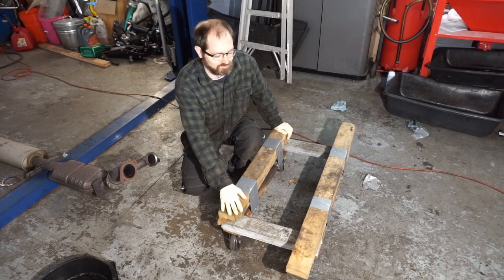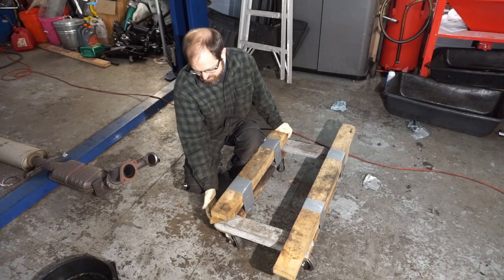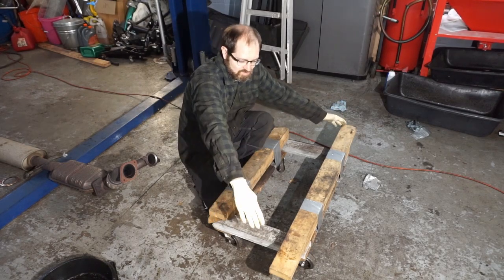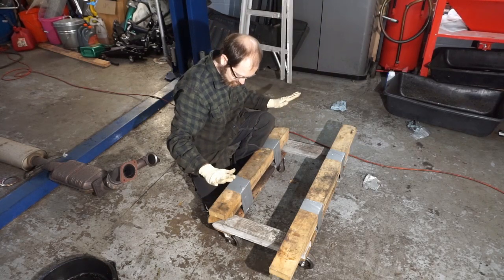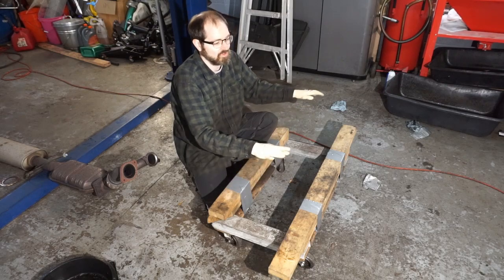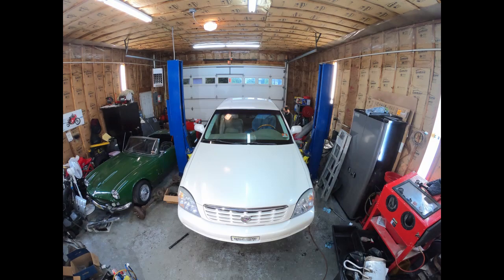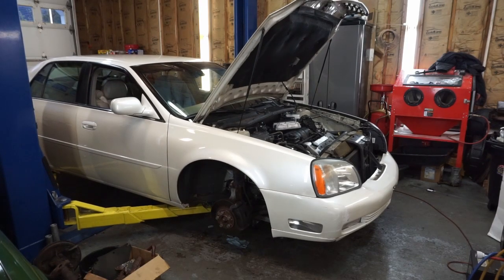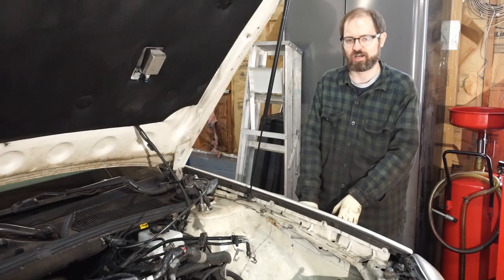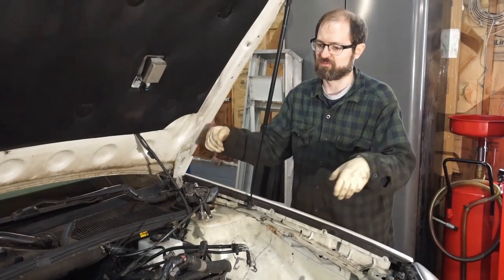We've made this support dolly for the cradle — it basically consists of a 1200-pound piano dolly made of hardwood, and then we have these two-by-fours as spacers. This one is a little bit wider for the front, and the cradle will just sit here and here. We basically balance it on top of this assembly so we can roll it around and do whatever we want with it. We're down on the dolly with the cradle. Now we're going to release the three bolts per strut that hold those in, then move on to the bolts underneath the car.